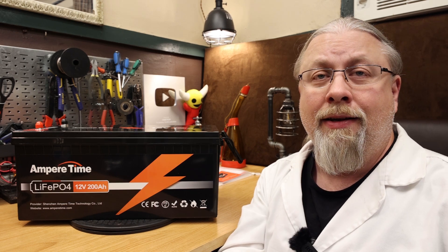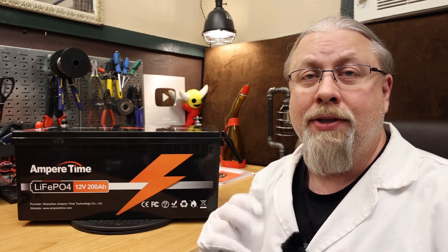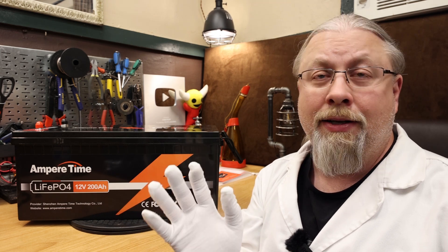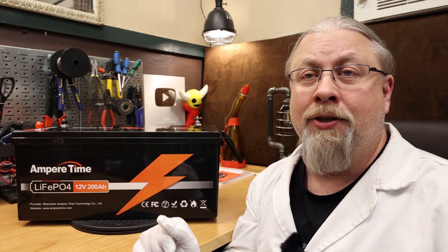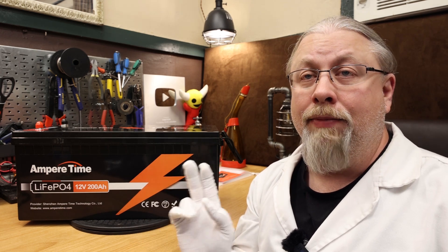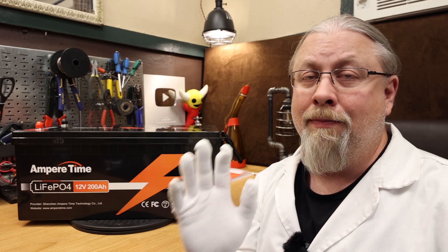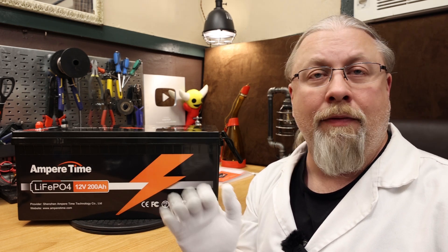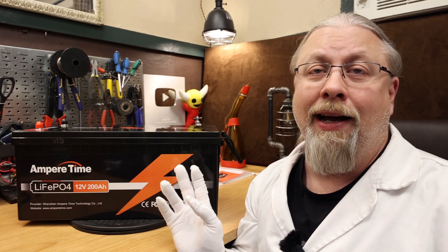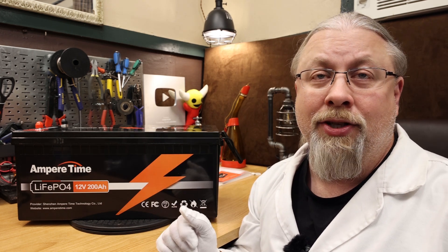There are a lot of rumors that if you have a lithium battery you have to replace everything in your RV — your solar controller, your battery charger. That's absolutely false in most cases. If you have a simple charger built in the last 30 years that can output 14.4 volts, you can charge this battery completely without needing a special lithium charger. Just be aware: if you kill this battery completely dead to zero percent, the BMS will shut off and you'll need to jump-start it from another 12 volt source unless you have a lithium-based solar controller or charger. Most of the time your inverter will shut off long before it hits zero anyway.